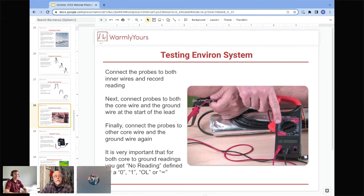The Achilles heel of self-ranging meters is they'll usually find the 200-ohm range, but when you hook one up to your floor sensor, it'll say zero, OL, or infinity — simply because it hasn't found the 20K range and doesn't know where to look. If you're stuck with a self-ranging meter, try pressing the range button while holding the wires — get a friend to hit range repeatedly until it finds the right range manually. That's why we recommend getting one of these inexpensive meters where you can manually set it to 200 or 20K.